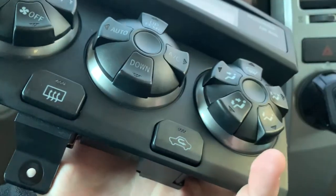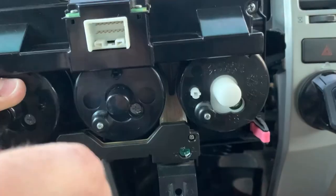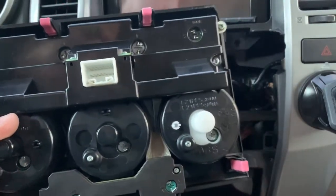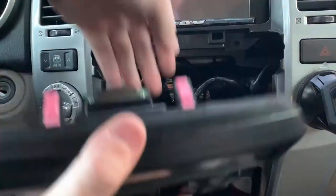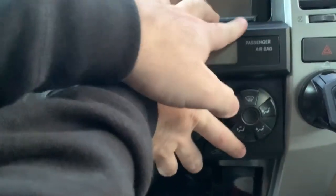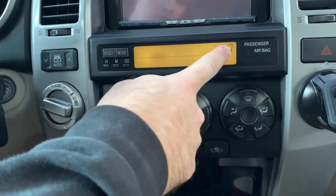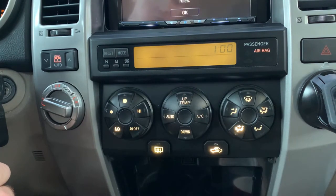The circulation one was bad. So you're going to twist it like you're going to take it out, turn it, keep turning it until it falls back in again, then lock it back in. It's just that simple. Do that to each one that didn't turn on and then let's test it again. Both sides are on — that's good. Let's turn on these lights and see. Now they're all on.